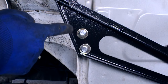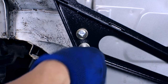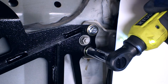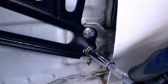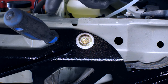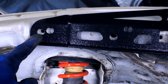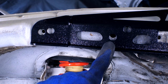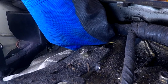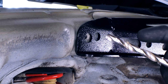I'm not an engineer, but I think that's a nice design. Now let's tighten up these two 10mm bolts to pull the arm into the unibody — be sure not to over-tighten. Now we'll zip in the door hinge bolts. Let's tighten up this top 15mm, and I've put a screwdriver here to prevent the tab nut from rotating. At the front, we need to secure the arm using these two holes. The hole in the sheet metal doesn't line up properly, and on this side there's a wiring harness clip, so first let's move the wiring harness — there's a plastic clip holding it to the sheet metal that we need to pop out. I'm just going to use a bungee cord to hold it back. Now we'll use a 3/8 inch drill bit to drill out the holes.